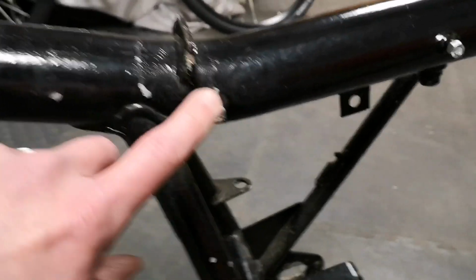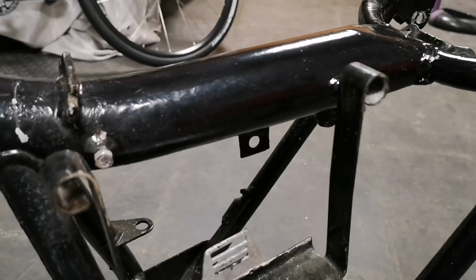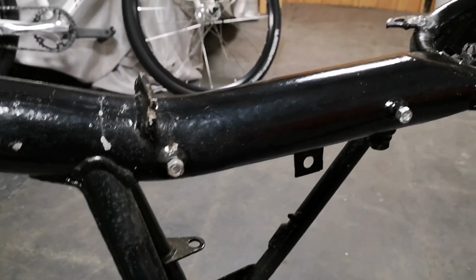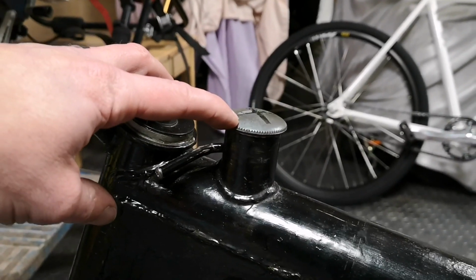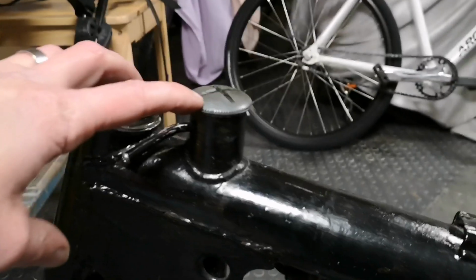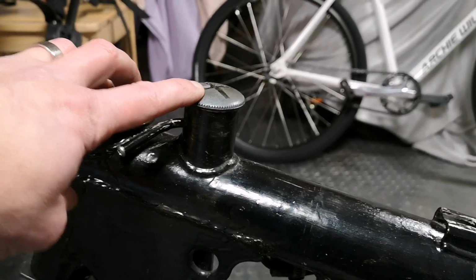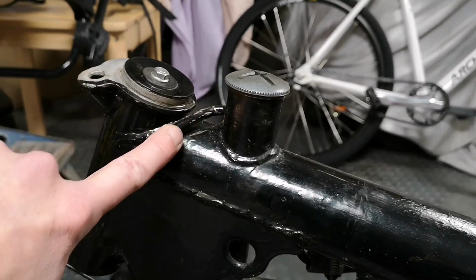So on the frame, there's 2 tubes that go through the oil in frame tank for where this hanger hangs on there. So I've put a bit of M6 all thread through there and a couple of nuts on, just so that doesn't get filled full of paint. The dipstick hole for the tank is exactly the same as a rocker inspection cap. I had an old one in the drawer, so I put a new fibre washer on it. I've screwed that on nice and tight to keep everything out of the oil tank. There's a self-tapping screw plugging up the breather hole.